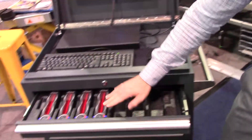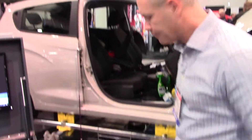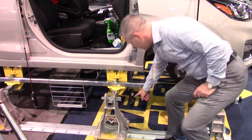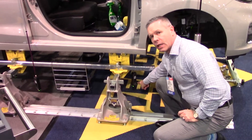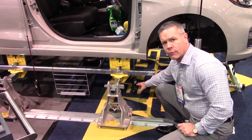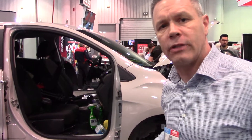This three-dimensional measuring tool comes with active live targets so technicians have the ability to see vehicle damage in or out of spec without being up near the computer system. You can actually see the live targets down here. The color of the live targets is green right now because the vehicle is within factory specifications. If the specs were out of factory specs, the bottom of the target would be red.